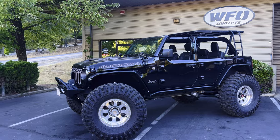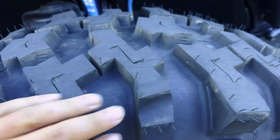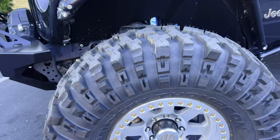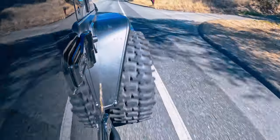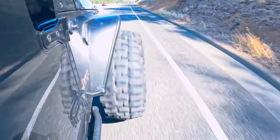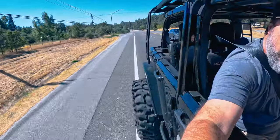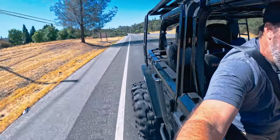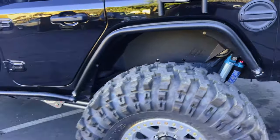No lights going down the highway. A lot of you might ask about these Mickey Thompsons — giant treads, bias ply tires. Are we ruining the 392 putting this big of a bias ply tire on it? Is it going to drive down the road? We were skeptical. Took it on a test drive at 70, 80 miles an hour — it takes a little bit of time for the tires to warm up, but you can comfortably drive one finger down the highway, ripping and enjoying it. It also has the Magnaflow TrueDual rear exhaust setup that gets rid of the muffler underneath the back and tucks up underneath — sounds really good.